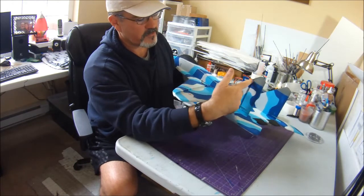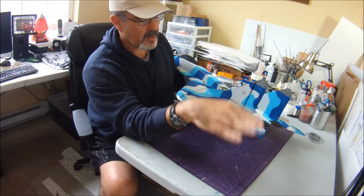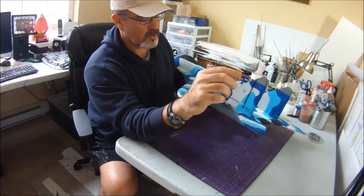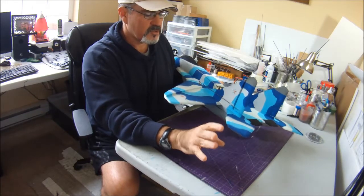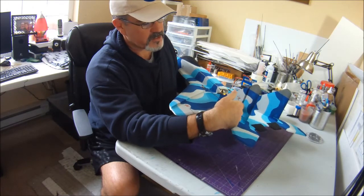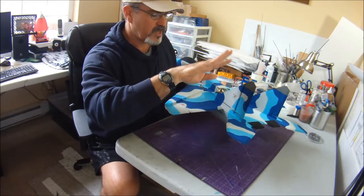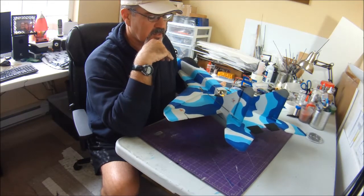What it does is, because we found through testing and comparing it to angled rudder hinges, that if you pull up, you want to do a stall turn or a hammerhead or something like that, the vertical hinged rudder and trailing edge, when you crank the rudder over, it should just move in the yaw. It doesn't induce roll. What we found in testing was that there was a far greater tendency with the angled rudder hinge, when you crank the rudder over, for it to also make the plane roll. So we wanted rudders that when we kicked to do something in the yaw, it did only the thing we wanted to do in the yaw, not in other axes.